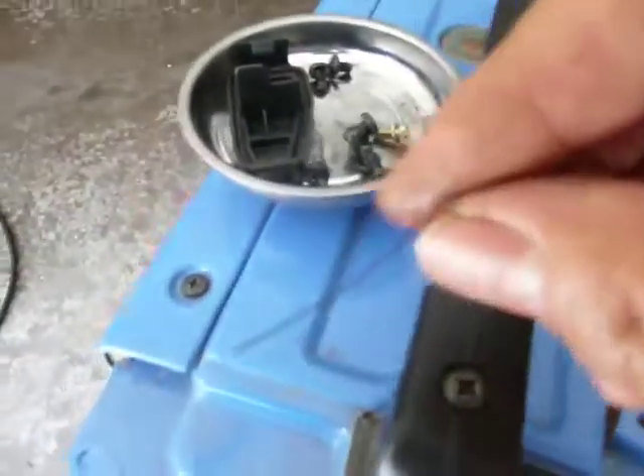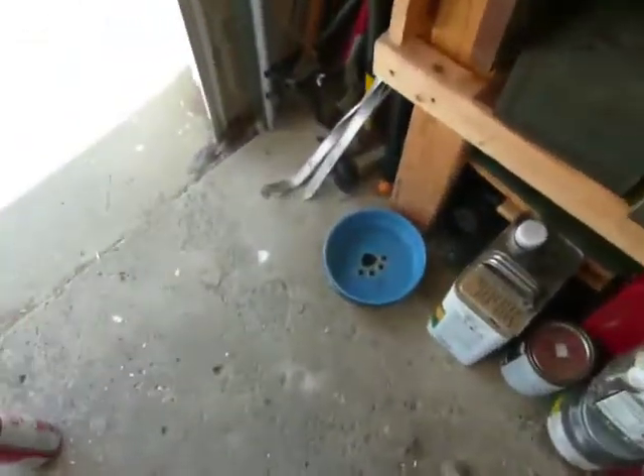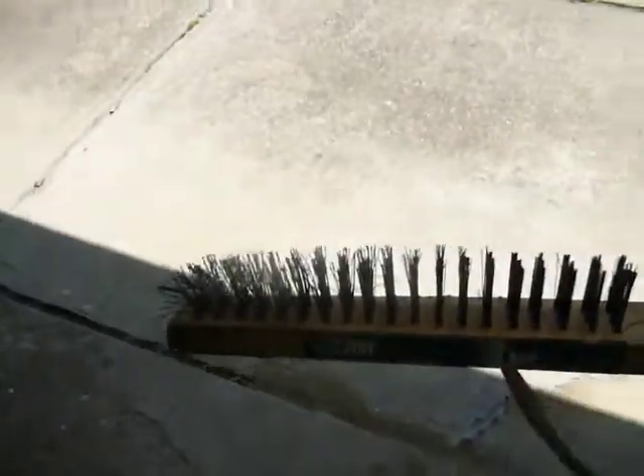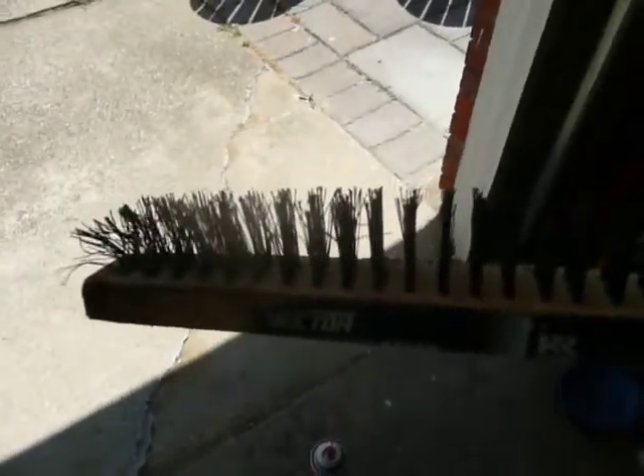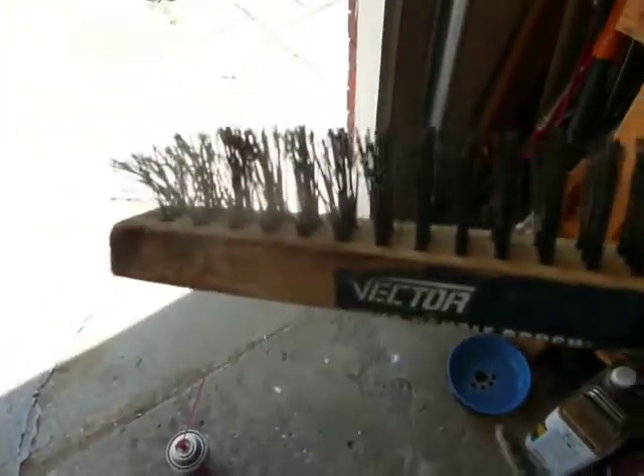The carburetor itself is just like any carburetor. Use a 10mm wrench to remove the bolt underneath and take off the cover. It has a fixed jet that was gunked up by old fuel, so I cleaned it. If you don't have very tiny wires, you can pull a single wire off a metal brush — just pull one out. They're perfect: small and tough. You can clean those tiny holes with that and not cause any damage.